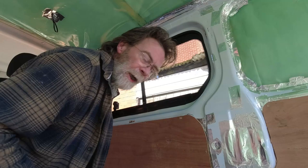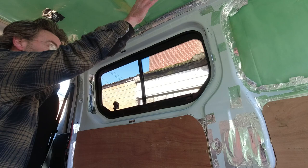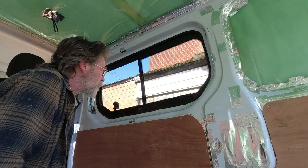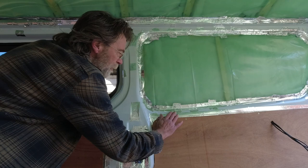The idea is to attempt to do this in one continuous piece, starting up here right in the top corner against that ceiling line. We'll glue that on first and then work down the van. I've done some of this before, a little bit not much, so this will be an interesting exercise. We're going to get it right into this corner, and obviously this panel will be cut out and carpeted up to the line here - to the wood, the buttons we put in earlier.